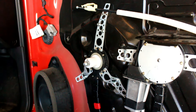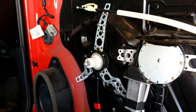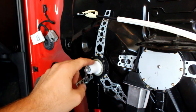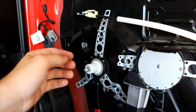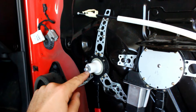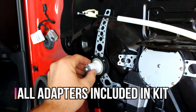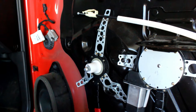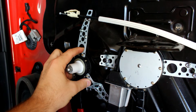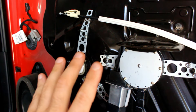Fast forward a little bit — I've attached one of the window crank assemblies and the sending unit to the door panel. Nothing's wired up yet, but I want to show some key things. I found that a longer adapter spline works much better on Chevys because the splines are way out toward the end, and the longer adapter gives more spline contact. They give you 10 brackets; the instructions show to use three on the motor unit and two on the sending unit, which is what I did using my own self-tapping sheet metal screws.